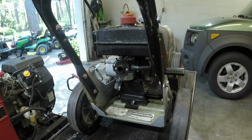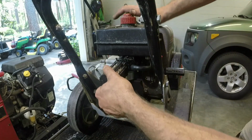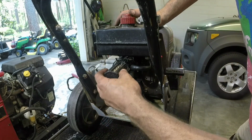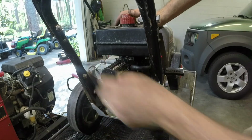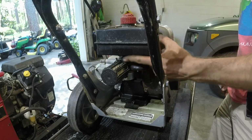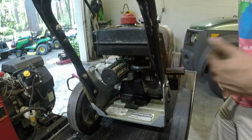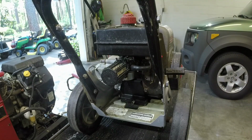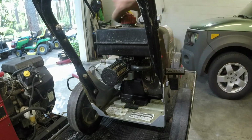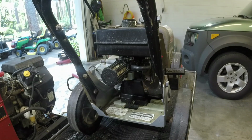So we got that going on, and the air filter is the last thing to do here. With this choke setup, we actually are able to get a grip on where the choke is. So the choke goes forward and backward. Forward is choke, backward is off. So that's not too bad. So we basically retrofitted this carburetor on here. Most Tecumseh horizontals are basically the same thing anyways. So nothing crazy. I'm going to get some gas.